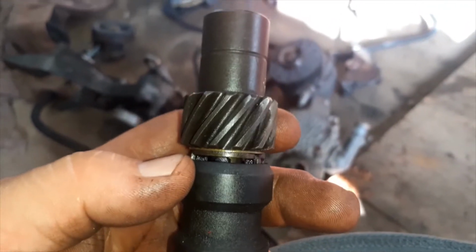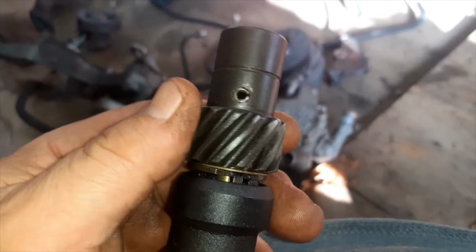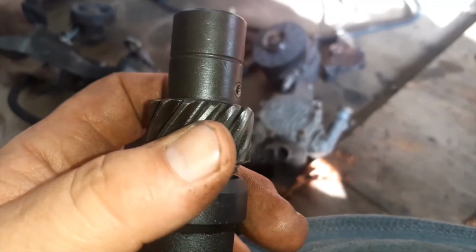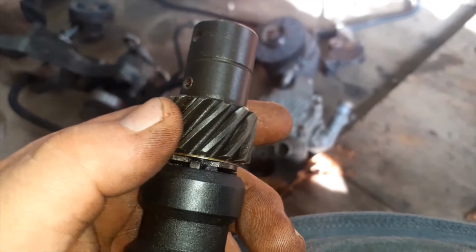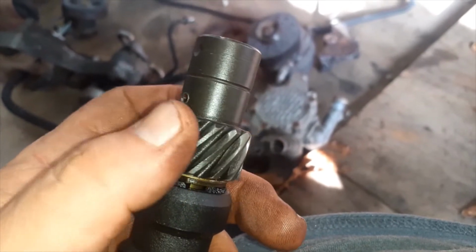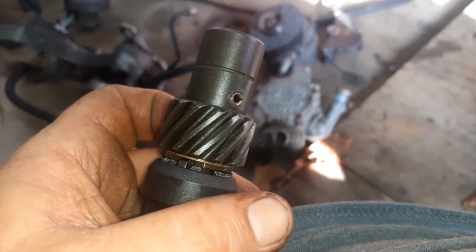Budget build. But anyway, guys, don't use the high volume, high pressure pumps in these. Just use a stock replacement pump, because that's what tears these up for some reason. I don't know why. I believe these are supposed to be melonized gears, and those are what you're supposed to run, but it depends on the core, on the cam gear. Melonized gear usually plays nice with everything. But I'm going to put this one in it.